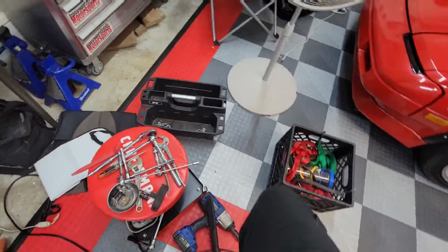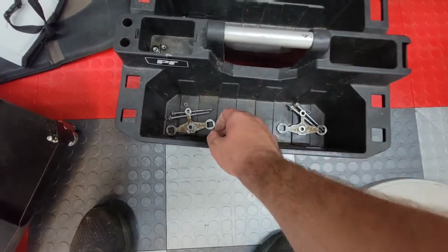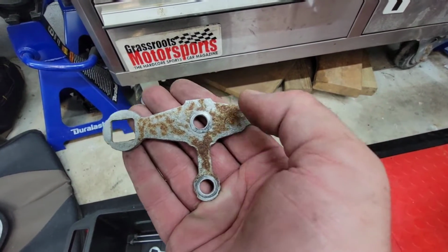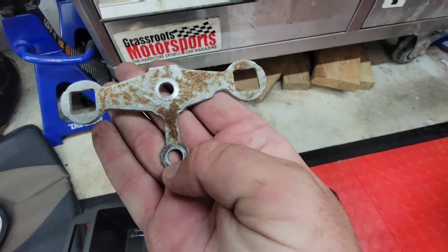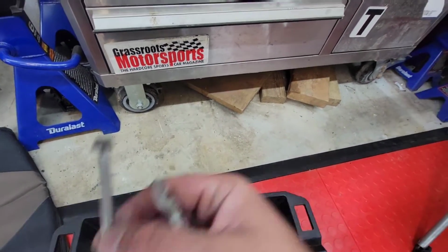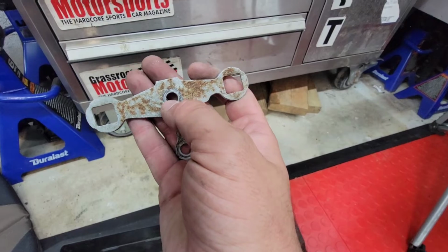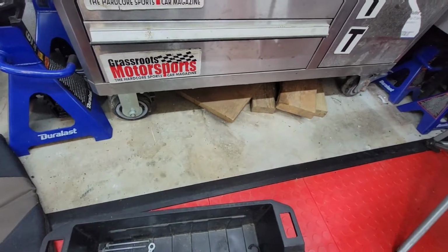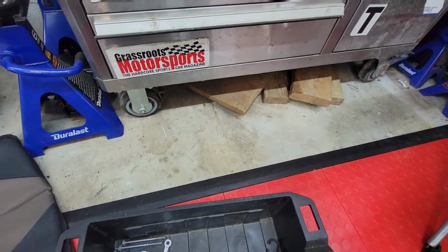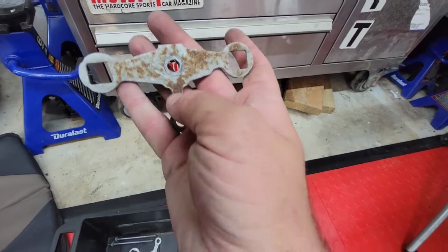The only thing that holds these injectors in are these three brackets you can see right here in my parts bin. They have this bracket, which basically sits in this orientation if you're looking at it from the passenger side fender. You have one bolt, a longer 10mm bolt, that comes out pretty easily. And then right here you have a nut and a bolt. You have this small 8mm nut, which holds down, I'm assuming, the ground wire, and underneath that you have a 10mm bolt, which comes out as well. Both of those come out from this section.